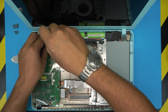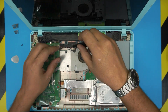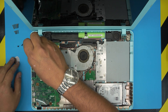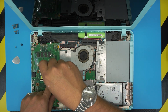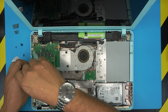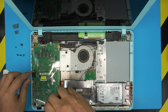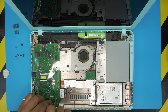Before removing the motherboard, remove the screw on the battery corner and one in the middle. Then loosen the motherboard screws: the chrome one near the hinges, the heatsink cover screw, the motherboard screw near the bridge, the one by the Wi-Fi, and the one at the front end of the laptop.